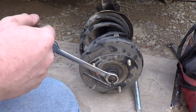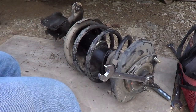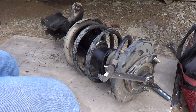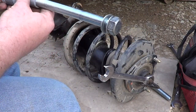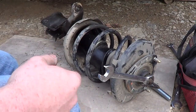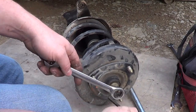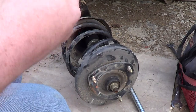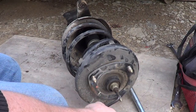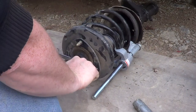I can't really figure out a good way to do these coils and squish them. There's only like two loops on these things with this compressor. I don't understand Harbor Freight stuff — I will get my money back. So what I'm going to tell you: I'm just going to spring this thing loose. The Allen wrench inside this one is a 6 millimeter, and the 17mm — the ratcheting wrench is your friend here.